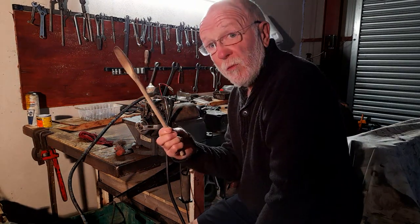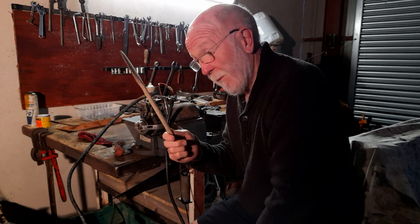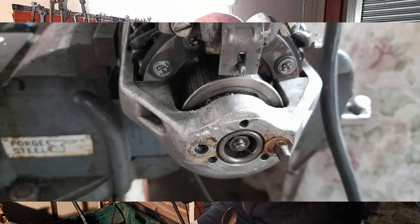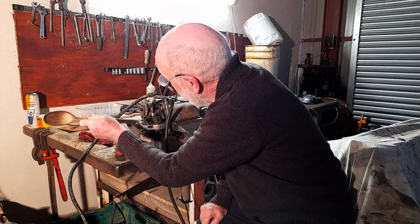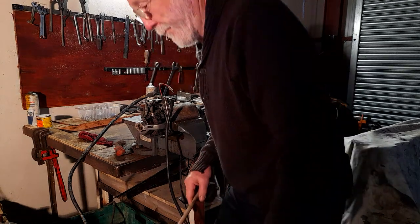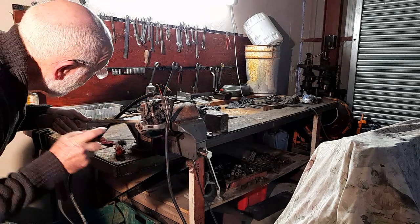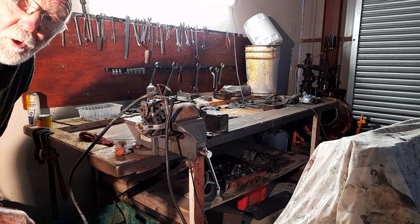Unfortunately I don't have a starter here displaying this problem, so we'll pretend the starter is faulty. You go to your kitchen or galley and get a wooden spoon — the same wooden spoon you use for stirring your porridge or disciplining your grandchildren. If you look carefully at the end of the armature, you'll see a stainless steel ring or disc. You position the wooden spoon against that ring, push the whole armature forward until it engages in the ring teeth, then hit your button — bang, your starter will engage and your engine will start.